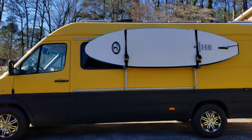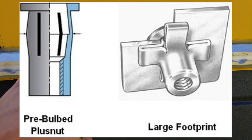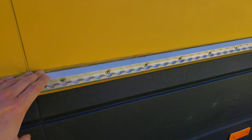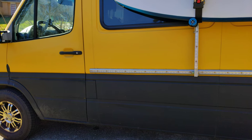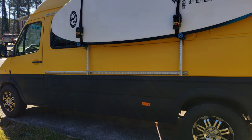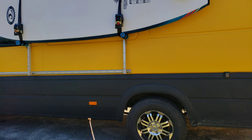What I've done to my van is add this L-Track system. The rail is screwed into plus nuts that are attached to the sheet metal, and I also used an adhesive to attach it to the side. There's plenty of holding area with all those plus nuts and adhesive — I use a similar system but a different adhesive for the solar panels on the roof. Currently this rail only runs for a portion of the van — about an eight foot length, which was the maximum I could purchase online. I'm going to put another length on the back. I've previously purchased this L-Track in even longer segments but had to go to Summit Motorsports to pick it up directly because they wouldn't ship it.